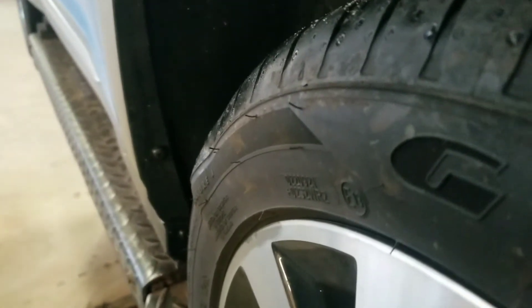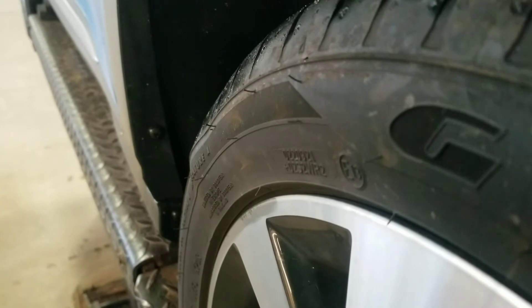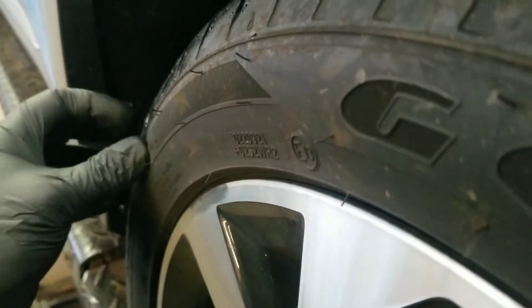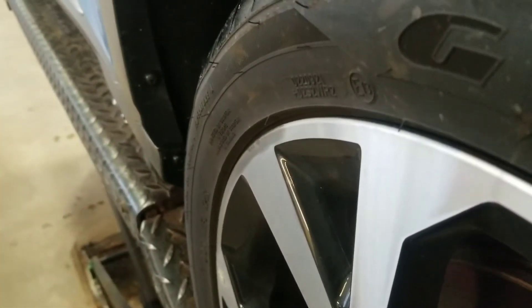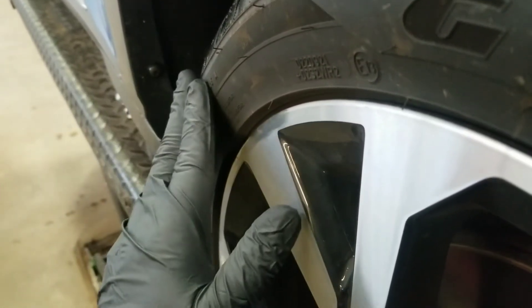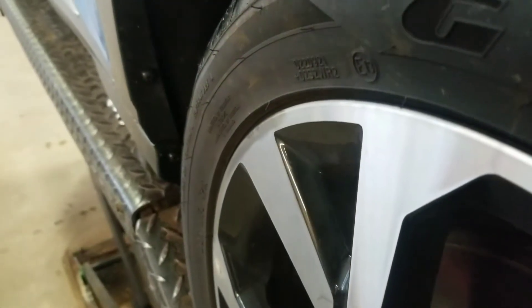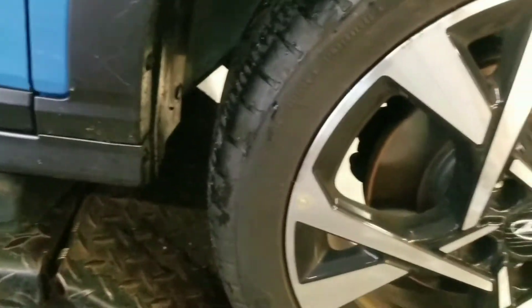Watch it as it does. It's completely gone — we let the air out. That's a weak point in the tire. If you keep going on it, it would be a risk to blow out down the road, which if you ever had a blowout could really scare the crap out of you if it's loud enough. I'm going to replace this tire and that'll be the fix for this.